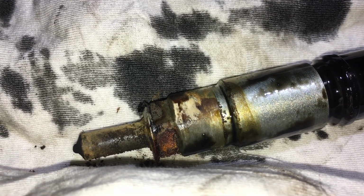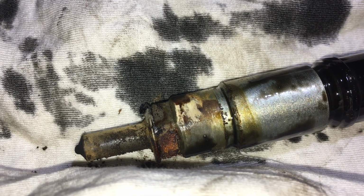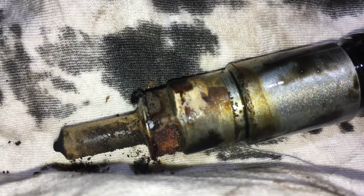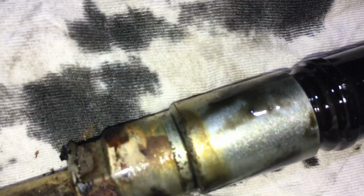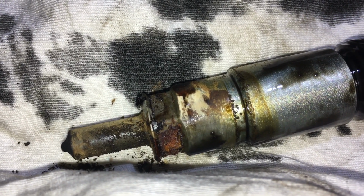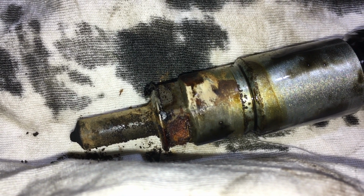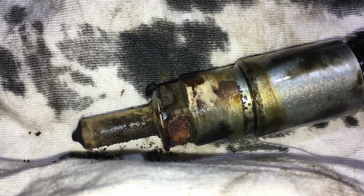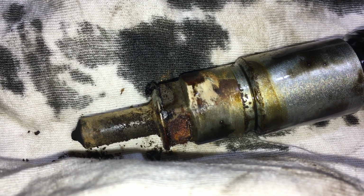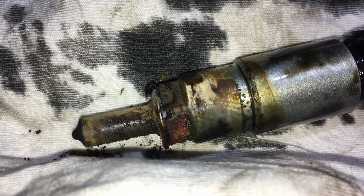Now, we've got some up on the wall, those Bailey's ones that had the brass washers, from a number of different vehicles. Let's go over to the wall of fame and compare the difference. These have done nearly 230,000 Ks with copper, and not a big deal. Only a little bit stuck is how I'd describe these, compared to the brass ones that are phenomenally, ridiculously, stupidly stuck. I promise you, I spend hours on those, and you come up the next day feeling like you've been in the gym all day the day before. It's probably good muscle, but bloody hell, it's sore. Anyway, let's go to the wall now.